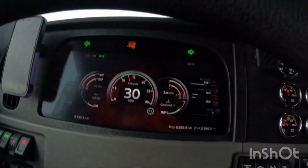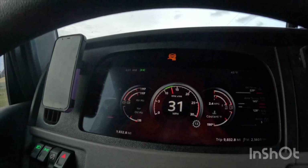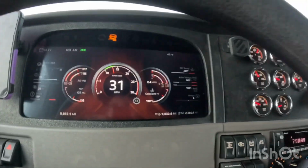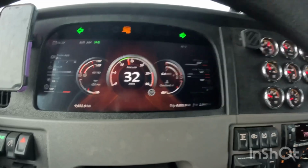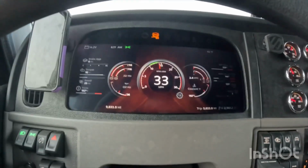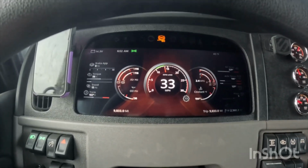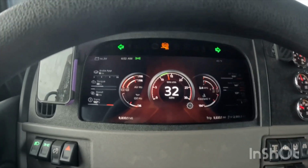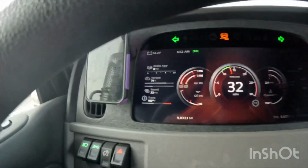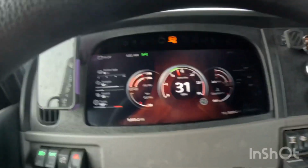See, now it's going up in temperature. I am going full throttle so I can get up this hill a lot faster, but I usually don't do that. Now it's going 190. Switch it on at 195. See, I stop. Now that I see it's gonna be a little flat and I'm gonna catch some speed, I'm just gonna chill. It's a little bit too high of an RPM. Leave it at 13.5, 14. That's where I can chill, where my torque can be at 80%, so it's not full throttle. That's where I chill.